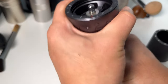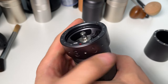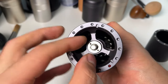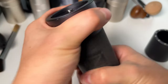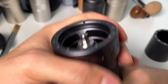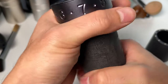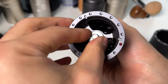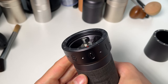After assembling your grinder, turn the dial to the finest position. If the red dot is on the left side of the number zero, first turn the dial towards the coarser end, then push the burr up and turn the thumb nut clockwise a bit. Now turn the dial back to the finest setting. Repeat this process until the red dot is back to zero perfectly.